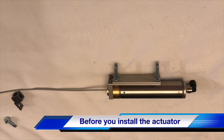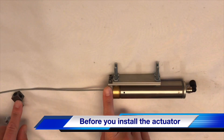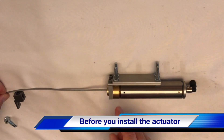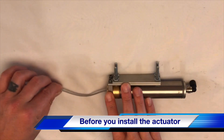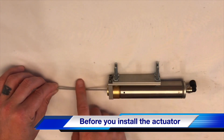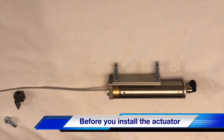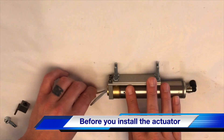The most common reason we see cable breaks is because there isn't enough cable between the end of the actuator and the anchor on the firewall. When the towed vehicle is being driven normally and the driver pushes on the brake pedal, it's actually bending our cable repeatedly, and eventually it's going to break where it's been bending. Ideally we're looking for three and a half to four inches in cable length, which allows our cable to coil rather than bend.